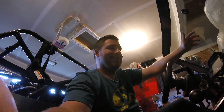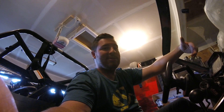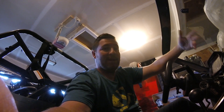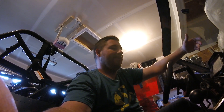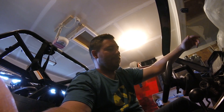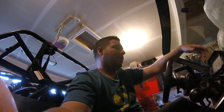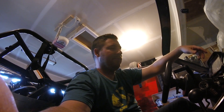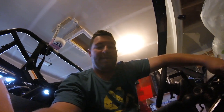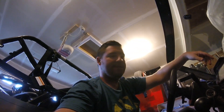Unfortunately, their harness doesn't come with two flying leads for those pinouts — although it comes with other flying leads, those are just blanked off. So I had to figure out what kind of connector it was, then locally find a couple of pins and install those, which just took a lot longer than it should have. But I have those installed and terminated with some connectors.